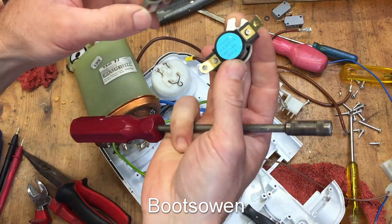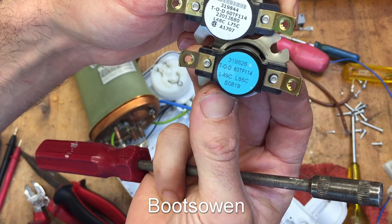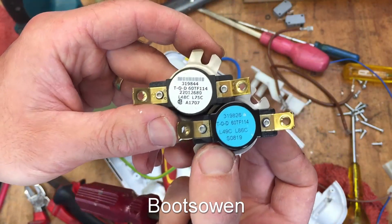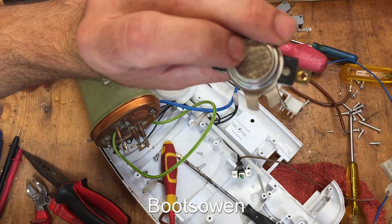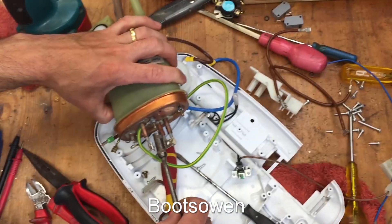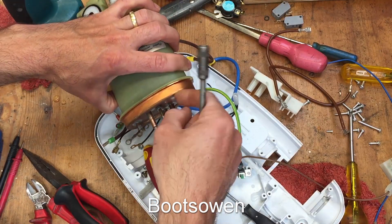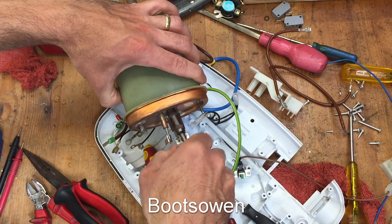Let's see the numbers on this: 319844, 319826, 60TF114. The codes are L48C, L49C, L86C, L75C — I don't know what the differences mean; if you know, please tell me in the comments. What happens is if it overheats, this thing pops up and clicks, and you have to reset it by taking it apart. I had one with a red ring that I used for years and I hated it, because the switch would turn off the water but not the element — a disaster of a design as far as I was concerned.